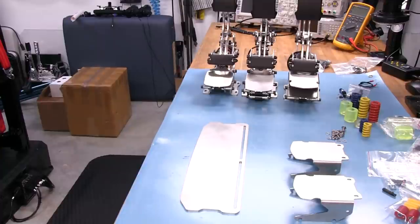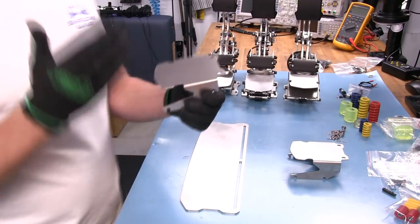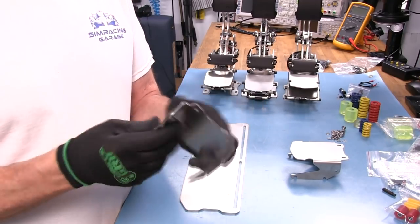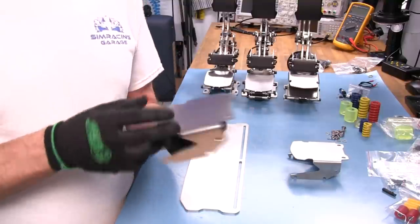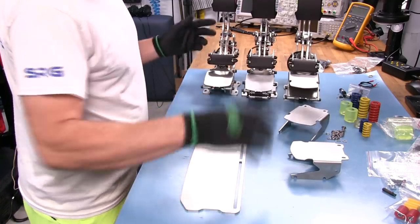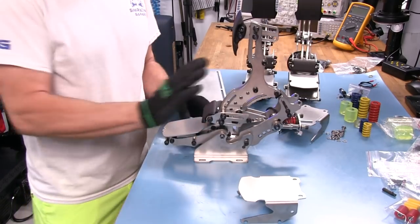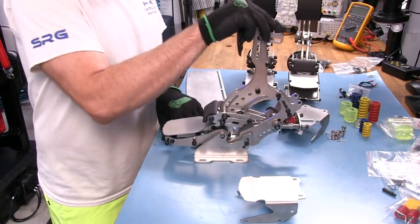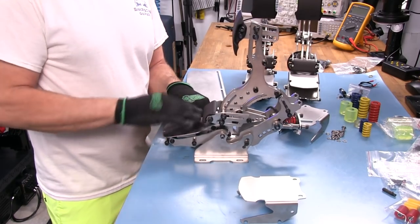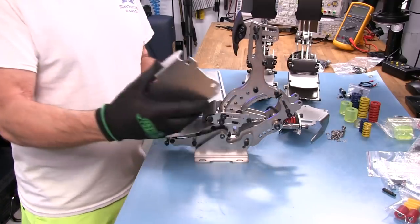Now we're going to take a look at how these fixed heel supports go onto the pedals. You get some brackets like this, and this comes with the pedals, part of the kit. And these, again, are all stainless steel bits here. There's two ways to do this. You can just mount individual plates, the idea here obviously being to get this out of the way. When our foot is on the pedal and we actuate it, everything moves, so our heel, everything goes, right? If you don't like that, then you can put these pieces on top. And that's what this is for.